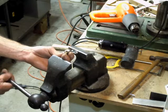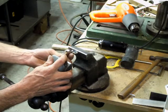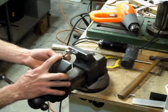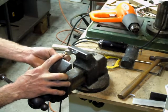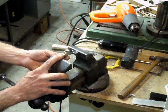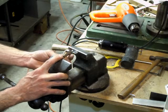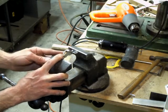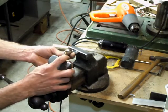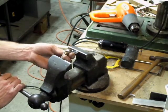It's just a little bit of pressure after you've got the thing heated up. Heat seems to be one of the main components — pretty much to loosen the glue. Big note on that: you don't want to use a torch or anything. You don't want to heat this thing up too quickly because you can ruin magnets. I'm pretty sure I've ruined a magnet by doing just that — the magnet came right off but it was really weak afterwards. So the key is to heat this thing up slowly, and you've got to have a lot of patience with this.